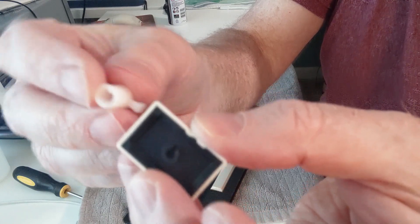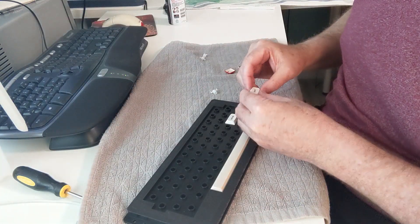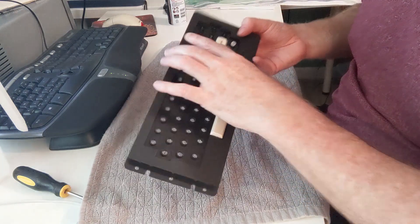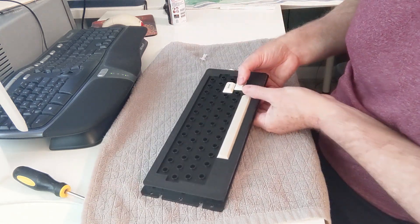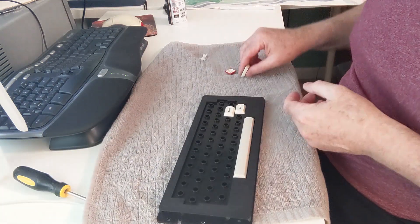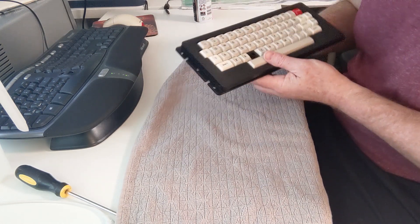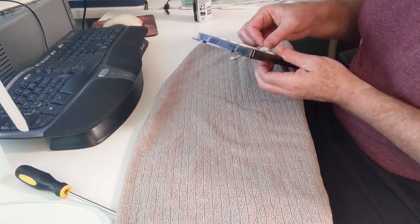I'm showing the tab — that's a nice feature of the design. You're not sitting there wondering, because I've gotten done and realized I swapped the O and the zero. I did make one mistake on this keyboard — we'll show it later. What I'm doing is I have my real PC in front of me with a picture of a Coco 2 on screen so I can see how the keyboard is laid out. For this sort of work, I recommend taking photos on your phone, but if you're putting a keyboard back together you can usually find a Google photo. Ironically, I get these last two keys wrong — the C should have gone where I'm putting this last key.